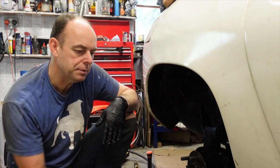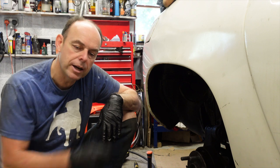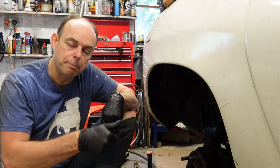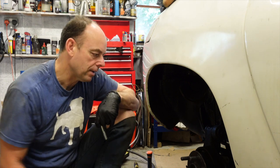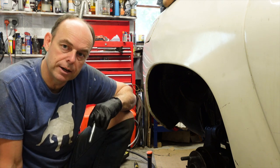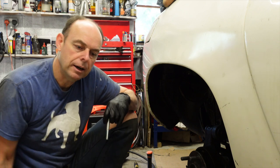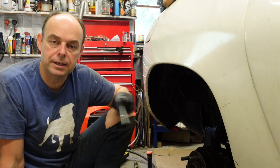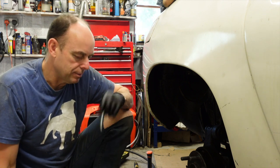Then I tapped it back a little bit, and by doing that, I ruined the thread, and I didn't have a nut on. And I've spent probably a day trying to file the end of the thread, to get the nut back on, but I just can't do it. So I've tried welding onto it, and the weld snaps off. So I've tapped it all the way back the other direction to the cross-threaded end, and now when I look at it, it's not cross-threaded at all. The nut was cross-threaded, but the nut was probably in a softer metal, so it just stripped itself. The actual pivot pin thread is fine, and it just had fragments of the nut sort of broken off on it. So annoyingly, I didn't need to do any of this. I probably could have got it out if I just put a nut on and then levered it out, as people tell you to do online.